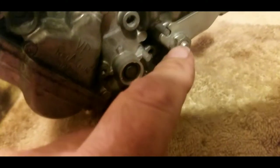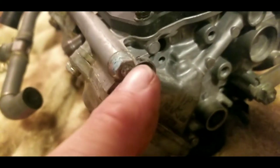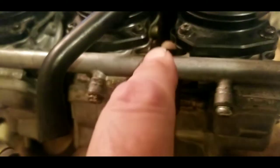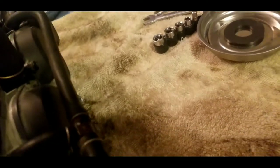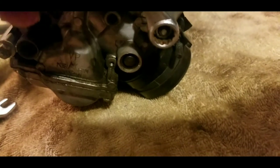The first step is to remove the enriching arm right there where your choke cable goes — remove that arm. Then we're going to remove this nut here and this nut here, and gently tap the carburetors apart. You have to be really careful because there's a bunch of little seal springs and spacers between where the carburetors go together, so it's a delicate process but not particularly difficult. I believe that's a 10 millimeter nut here on the choke arm.